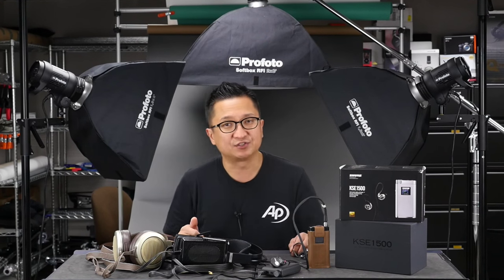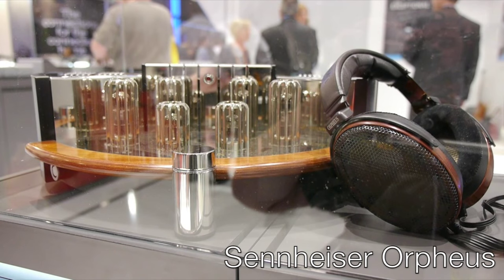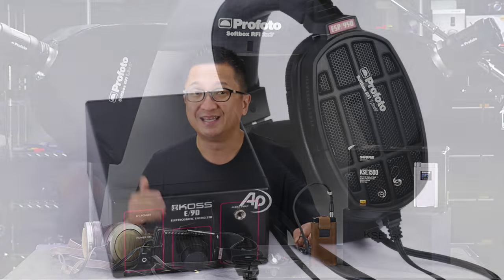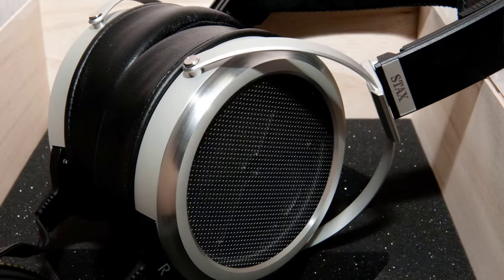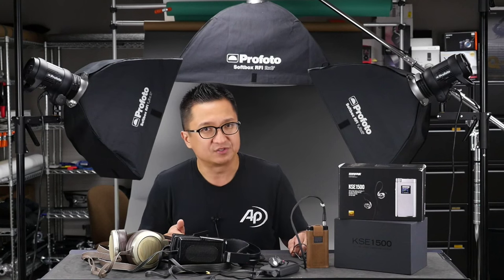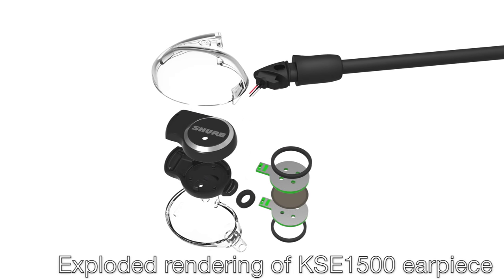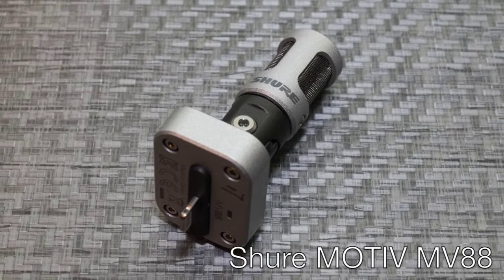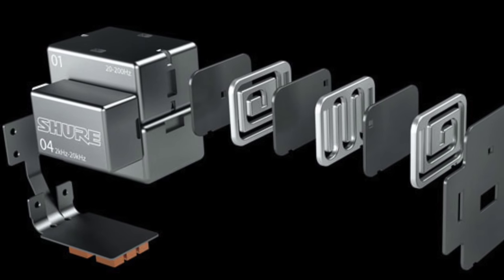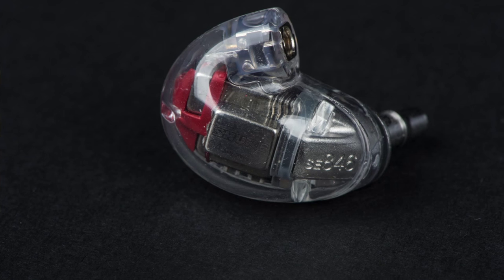With these qualities, it should come as no surprise that Sennheiser — a company whose headphones are pretty much exclusively the moving coil dynamic type — chose an electrostatic driver configuration for what many considered the best headphone ever made even 25 years after it was released: the legendary Orpheus. Koss also makes pretty much exclusively moving coil dynamic headphones, yet their flagship ESP950 is also electrostatic. And of course there's Stax, the electrostatic headphone maker, producing what many consider the other best ever headphone with their SR009. They require tremendous precision to do correctly in terms of engineering, tuning, and construction — and keep in mind how small the electrostatic drivers would have to be in the KSE 1500's earpieces.